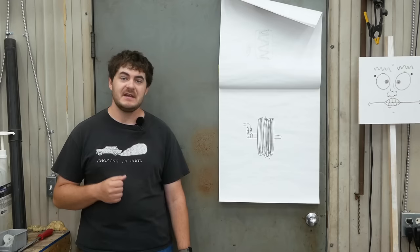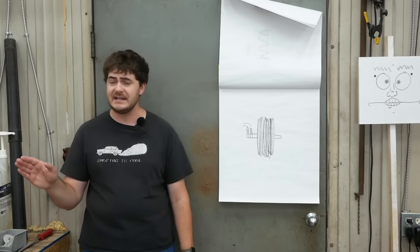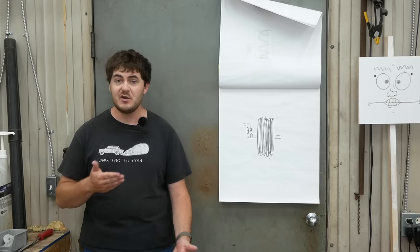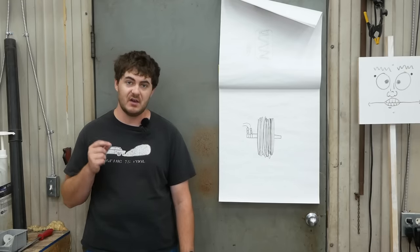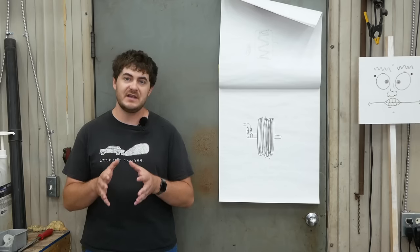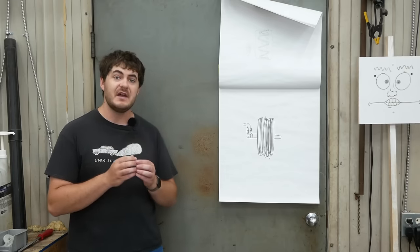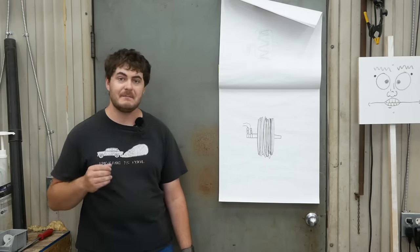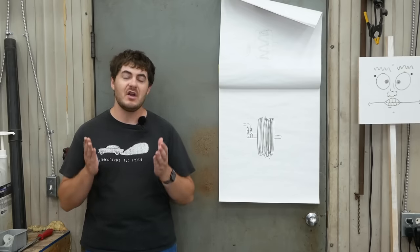The reason for this is voltage regulation, because an alternator is hooked up to an engine that varies in speed. If the rotor was a permanent magnet, then the voltage output would vary greatly depending on engine speed. You want your alternator to put out a constant 13-point-whatever volts no matter what speed the engine is turning. The way to achieve this is by having the rotor energized by on-board voltage regulation circuitry, which can vary the current going into the rotor — and therefore the magnetic intensity — depending on engine speed. At idle, a fairly high current is pumped into the rotor; at 5,000 RPM, the current is much less, so the alternator can output a constant voltage no matter the speed.